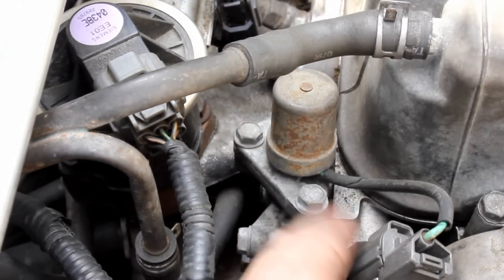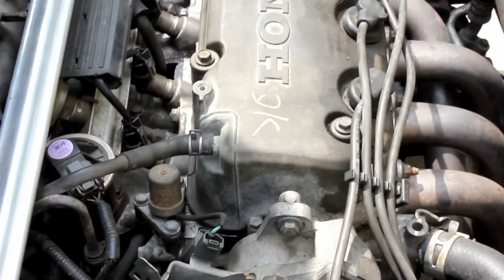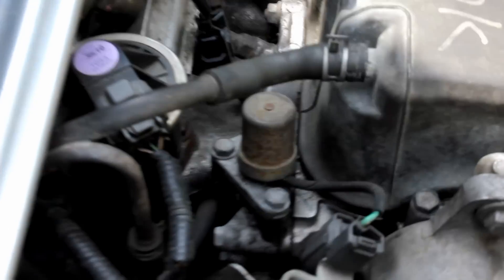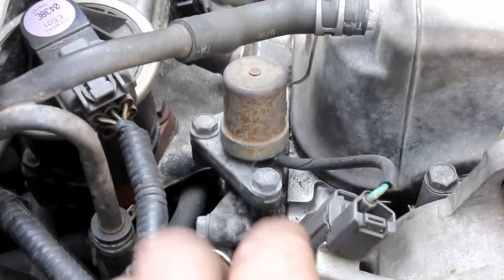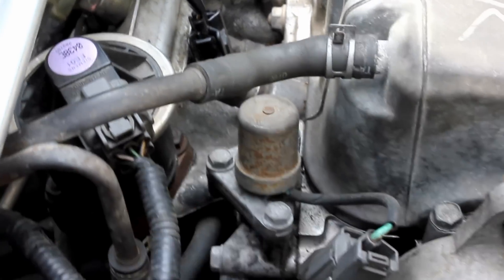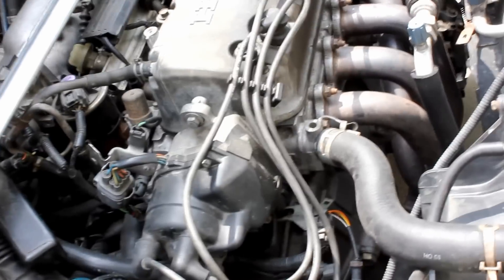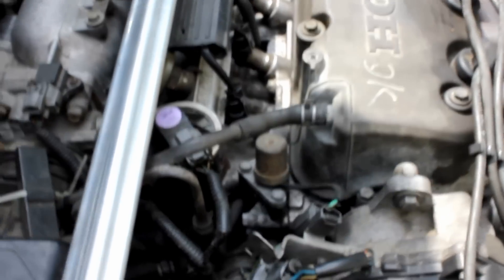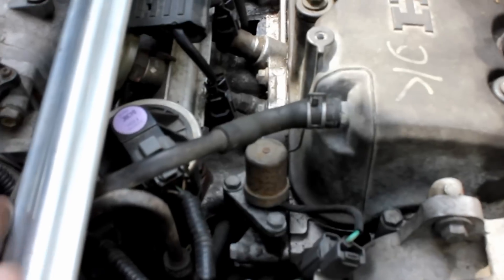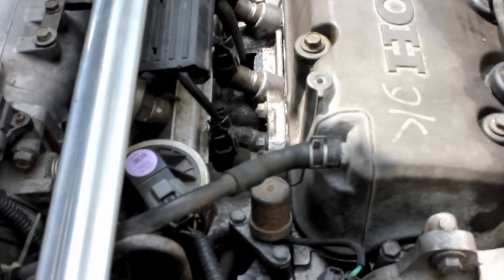It's got a single wire coming off it and it looks something like that. Now on the newer models I'm not sure whether you'll be able to see this so easily, but on this particular model it comes right off here, right off there to the side. Now there's also something that looks very similar to this — it'll have two little cylinders on top of it, side by side, and it'll be down here. If you have an automatic transmission, it'll be somewhere down over there, and that will be your automatic transmission solenoid — your shift solenoid. So if you have one of those, that doesn't mean you have VTEC, but if you have something that looks just like that, then your car does indeed have VTEC.